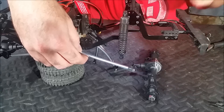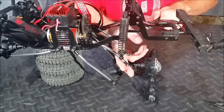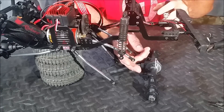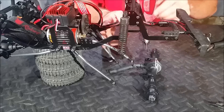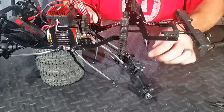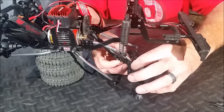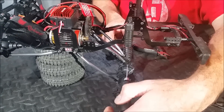Then you can go ahead and reinstall the links in the stock position. Likewise, with your upper links, rotate the links 90 degrees so that the arc is facing up instead of inbound like they were. If you leave them the way they're set up for the factory axles, they'll end up hitting your drive shaft. Once that's all done, we can start putting the axle in — get your drive shaft in. The easiest thing to do is put your upper links in first: put the screw through that link, then through your axle, then put your other link on, and install the nut.